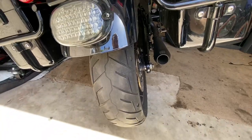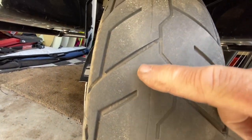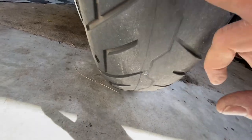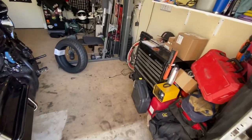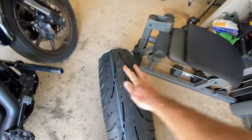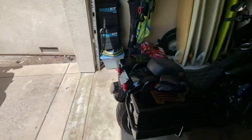I'll get it off there and show you. I'm gonna take the tire down to the slab sides for a swap out — I'm down past the wear bar and this gnarly seam showed up on the whole tire. I did good on this Scorcher, I got 11,000 miles out of this one; the last one I only got 8,000. I'm gonna switch over to the Dunlop Elite 4, which is a high-mile radial tire with metal in it. That was a bias tire, so I'm switching over to see if I can get more miles out of it.